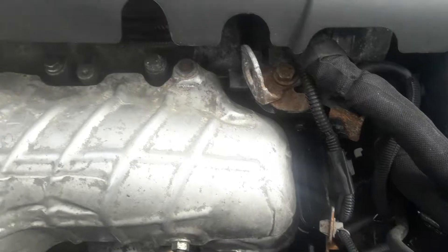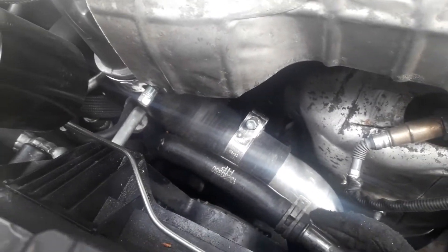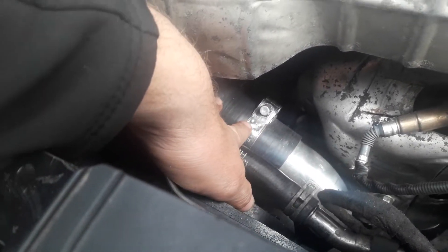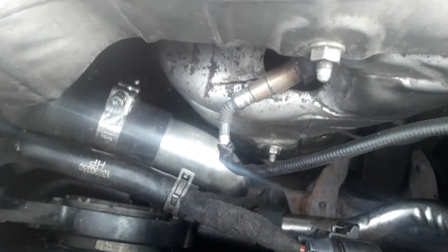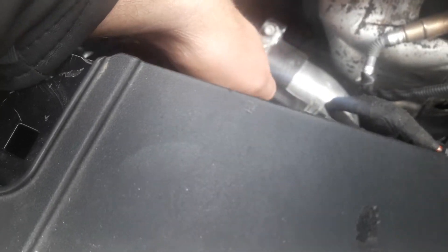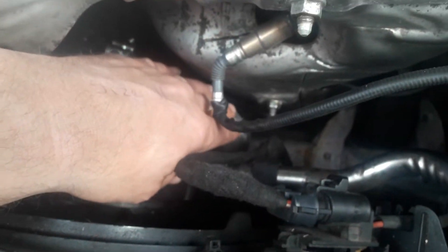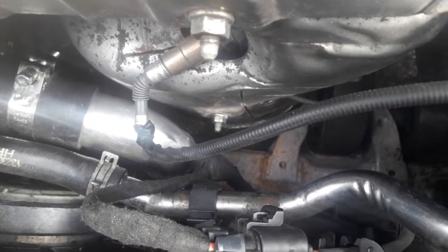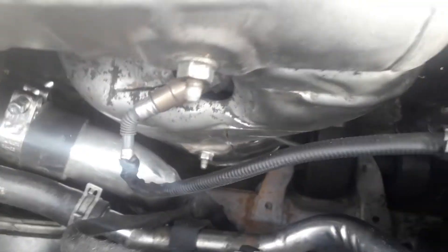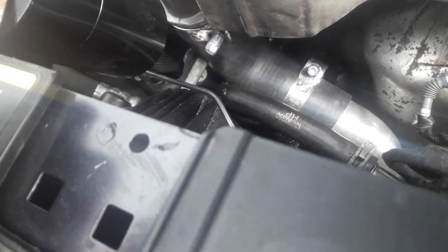All sensors are connected as normal. The pipe which comes off the bottom of the turbo — this silicon pipe here — also comes with a metal pipe. You put on the silicon pipe, bolt it up with the included clamps, and it goes into the metal pipe which then goes straight into the standard piping. Nice and easy to fit, comes with all the clamps, and the clamps are decent quality chunky items so you won't have any hoses blowing off.